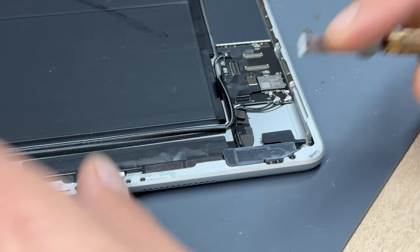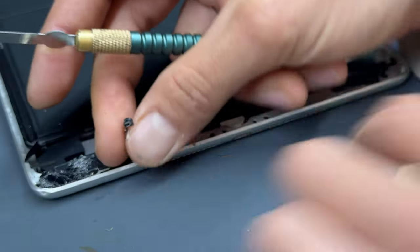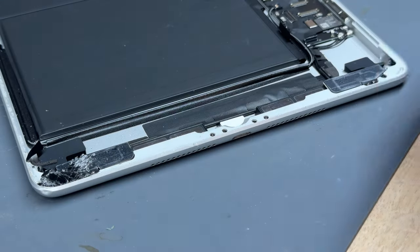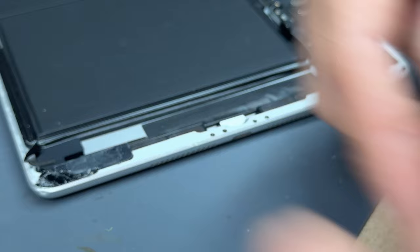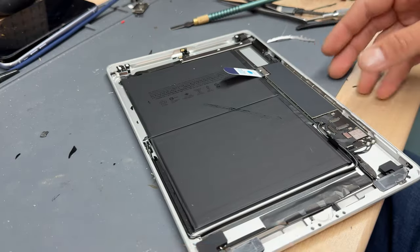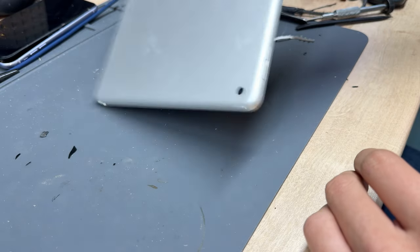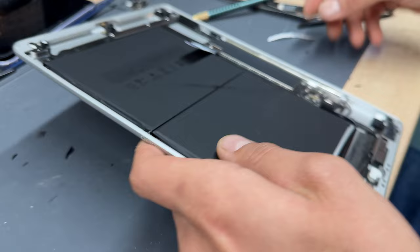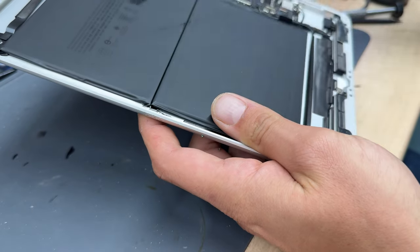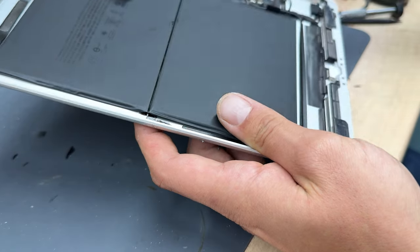It's much easier to get these broken bits of glass now that the screen's out of the way and we're not juggling an LCD and a digitizer in the other hand. Whilst running down this right-hand edge, it's very important not to pop the battery because it will explode. Now that that's clean, we can see there are still a few bits of loose glass — flip it over and give it a little shake to get rid of as much as we can. Use tweezers to get any remaining pieces out of the way, because loose glass can end up between the LCD and the glass and cause scratches on the display.